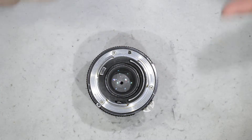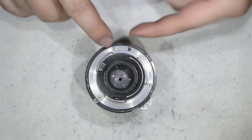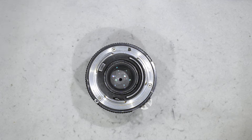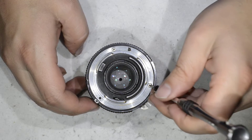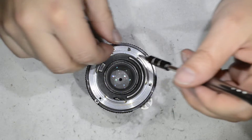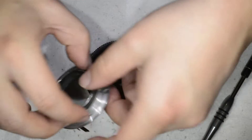This is an extremely simple repair because what happens is just dirt blocking the aperture ring. Or what can happen is that the clicking noise is not very strong because the little part that makes the noise is at fault. So let's fix that extremely quickly. We're going to remove the bayonet — this is valid for nearly all lenses, there are few exceptions, but in most cases the principle remains the same. There is a ring that moves just behind the bayonet, and the clicking sound is given by a very simple device.